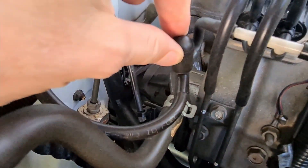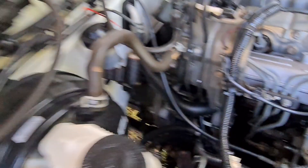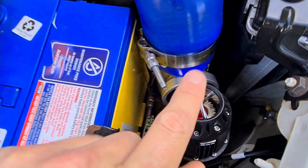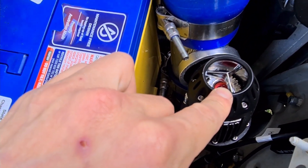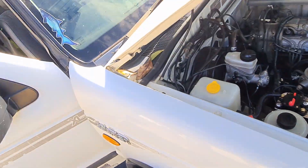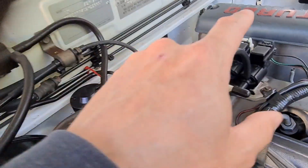Basically, that switch triggers this vacuum relay, which is plumbed into these vacuum pumps — just off a spare fitting that was on there not being used. The vacuum pump creates a vacuum which goes down into the blow-off valve, pulling it open when your foot's off the accelerator. For this to work it needs to be over five pounds of boost, but it'll work at any level of boost above that.